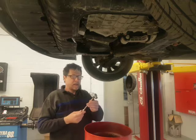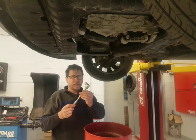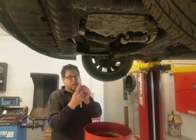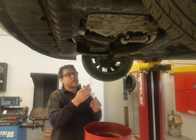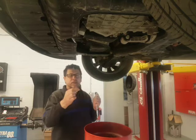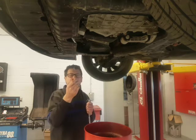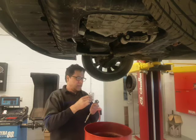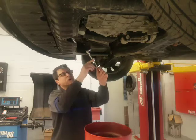We're going to remove the drain plug using a 3/8 ratchet. I don't want to see you grabbing a half-inch or any kind of power tool. Set the ratchet to the off position — lefty loosey. Get the correct size socket; we're going to use a 6-point. It fits nice and snug. This is metric — most cars we work on are metric. Make sure it fits exactly. If it's loose, find the correct one.